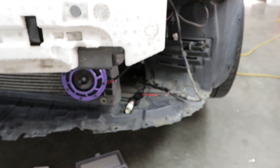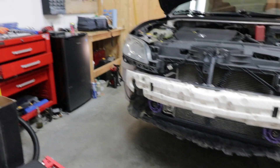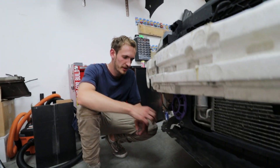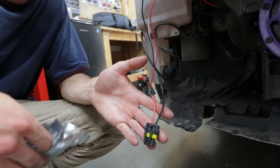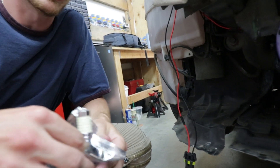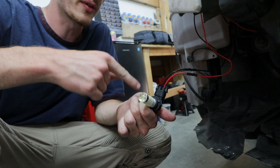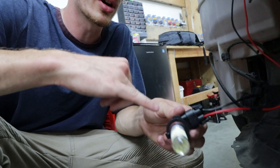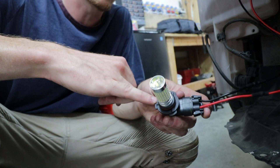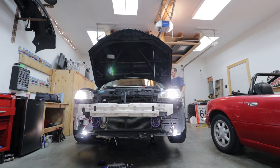Since we've done that side, I'm going to wire up this side and plug it in so you guys can see. You might have different plugs — I totally forgot what the OEM plugs look like, but either way it's the same situation. Note: this is a 9005 plug and a 9006 bulb — they're similar but different. Make sure you look up and confirm your bulb type. Go to AutoZone.com to verify which bulb type you have. Now let's go test them.